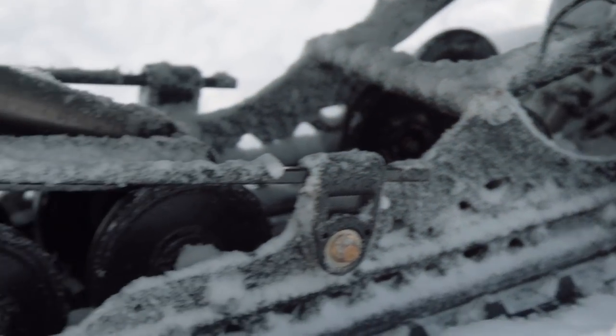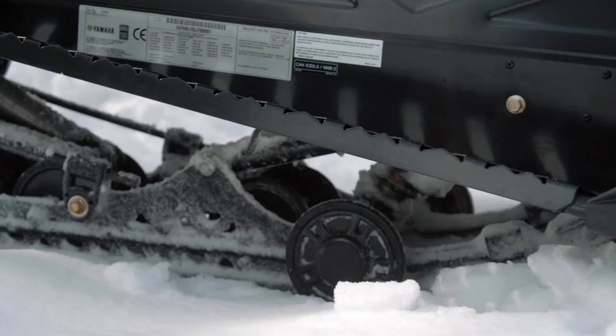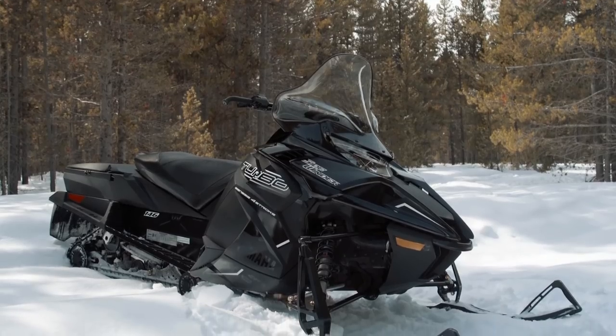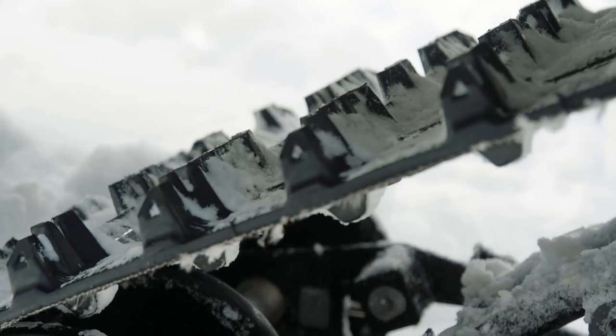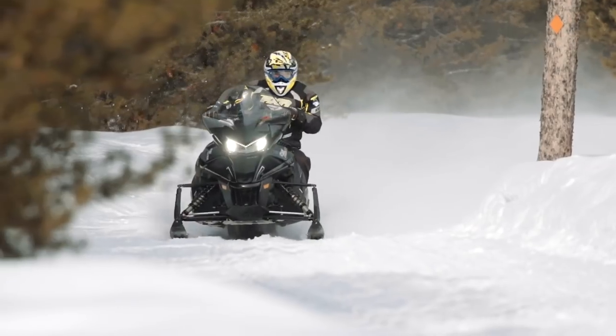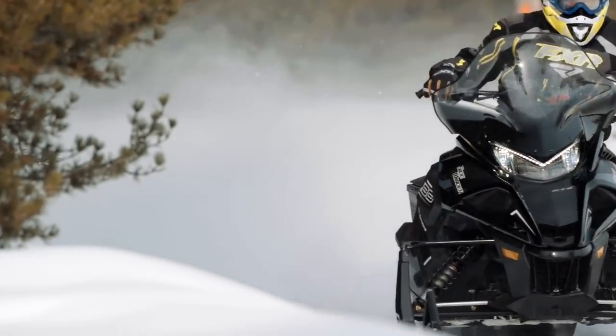This is the best riding snowmobile Yamaha produces in model year 18. The sliding front arm skid used here is renowned for its ability to swallow jigglers. When it's stretched to 146 inches, it bridges moguls and trail trash with the very best suspensions from any OEM. The 146 uses a 1.25-inch lug — another clue this sled is not targeted at deep snow navigation. In fact, that 1.25 is key in the STX DX's ability to literally rail twisty trails.